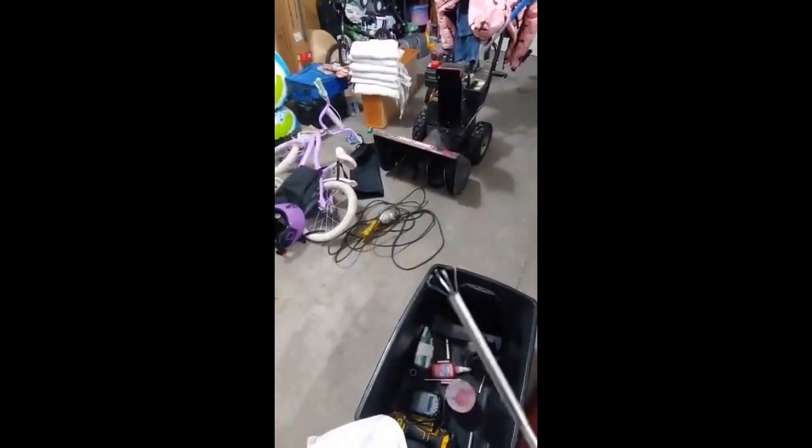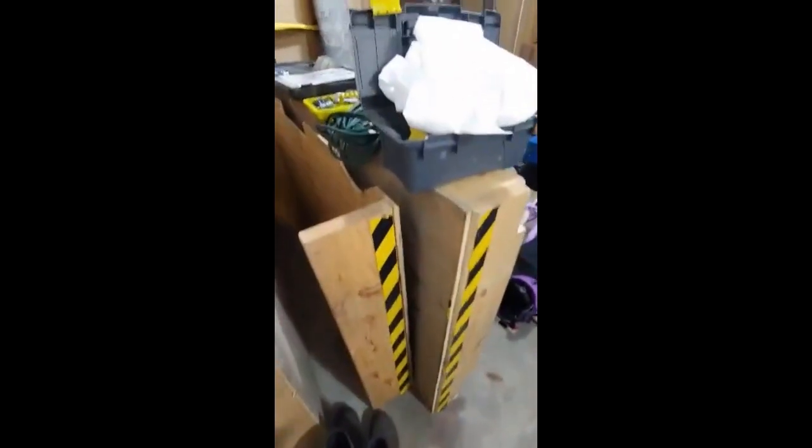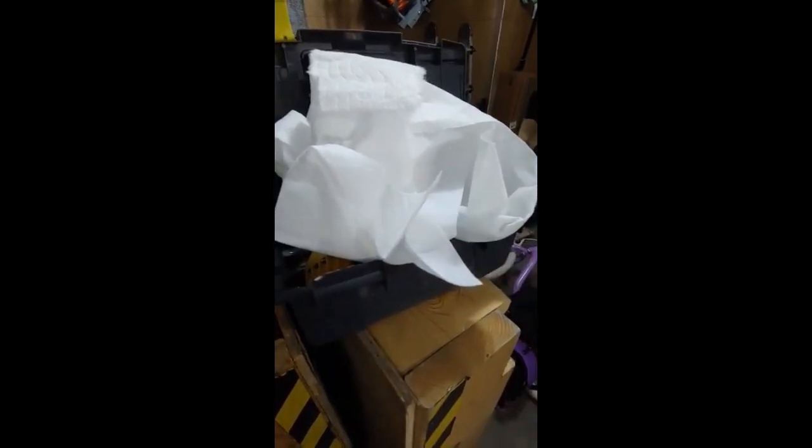Another thing I've been doing, which I think is pretty handy to keep that spark plug hole cleaned out as you're working it, is grab one of these claw tools, that type of unit. And then just bundle up a little chunk of paper and spray it with some brake clean, hook it inside of here and go down in there and swab that out.